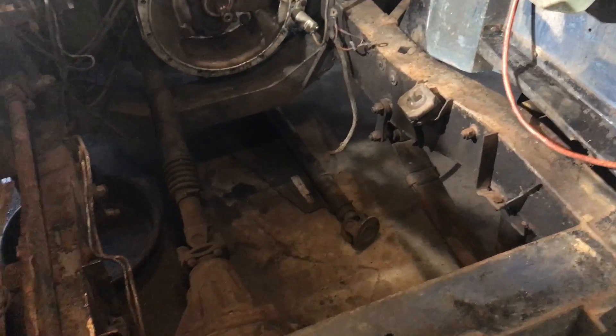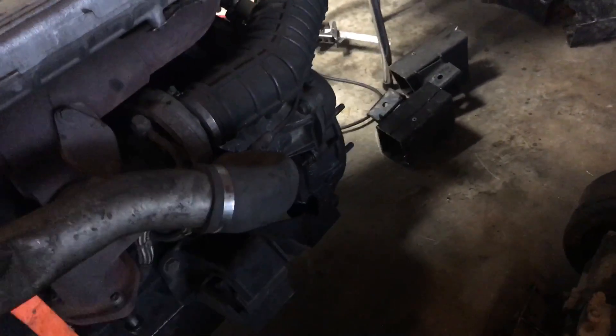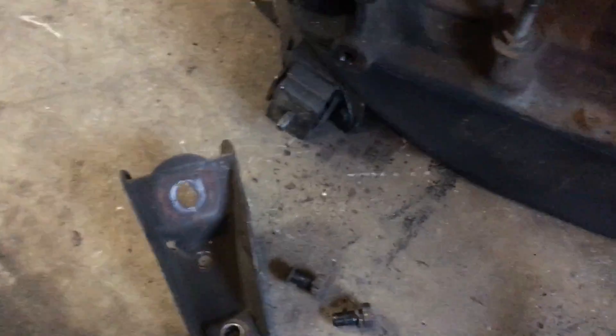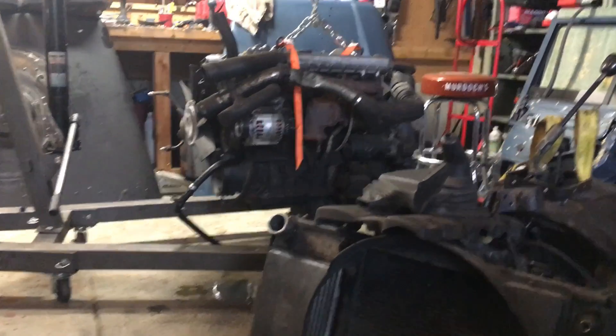One of the first things you'll notice if you take a measurement from a given point on your bell housing to the motor mount is that it's about twice the distance compared to the 300TDI's motor mount back to the same position on the bell housing. So what's going on? There's actually a need to pull the motor mount off of the four-cylinder diesel you're pulling out. I believe what's going to happen is we'll mount that to the forward motor mount position on the engine, and we'll give that an experiment to see if the measurements work out.